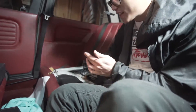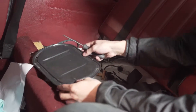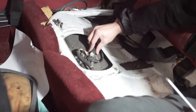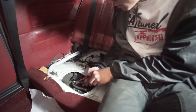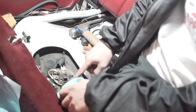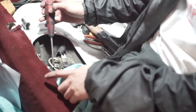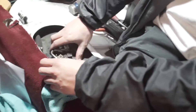This right here on the passenger side is where the stock fuel pump is, so we're just going to take off this cover. I've never actually taken off the fuel pump in this car specifically. The gasket's in really good shape. Pretty much there are some notches on the sides, so you get a flathead here and then you hammer it and it rotates it - and this already rotated quite a bit, and that's actually it.